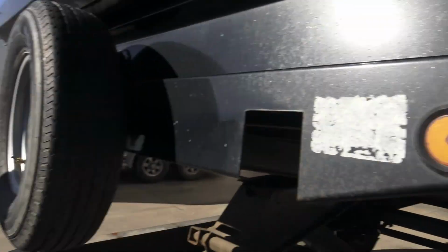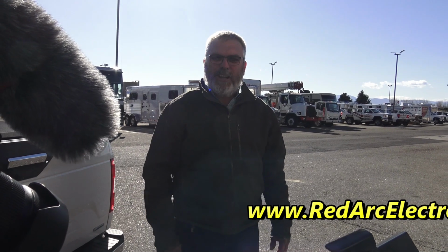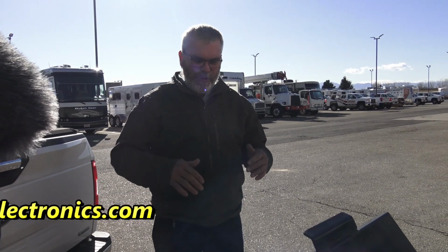If you run this battery too low, it will just shut off. Oh, well, that's a good thing. It won't die down and go to nothing. If it gets too low, it will literally just shut off. That's so cool. It's a lot better for your motors, your pumps, your solenoids, everything. So no more burning up the wires on my loom, on my trailers. Exactly. Because once in a while that happens. I got to where I had to separate all my wires. The lower your voltage gets, your amps increase. So this won't do that, because your voltage will stay very solid. You'll stay at 12.5 volts or better, which means your wiring is not going to have to pull as many amps, and your motors work better too.